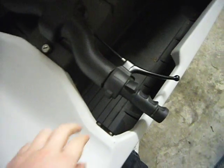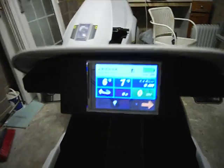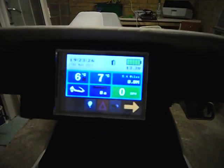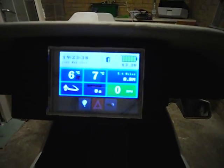If I use the indicator switch to turn the right indicator on, you'll see it's coming on as it should do. But also on the display it's flashing on there too, which is useful because I always forget to turn them off when I'm using it. If I turn that off, then the same goes for the left — you can see that there. So that's the indicators running through the Arduino.